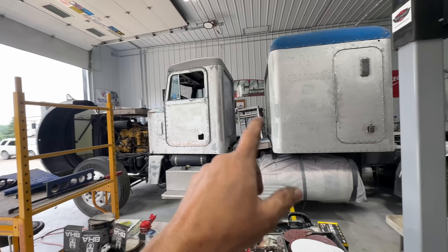If it says wait 20 or 25 minutes between coats, you want to set a clock and make sure you don't start putting the second coat on until that flash time occurs. Otherwise you encapsulate it and get what's called orange peel. Now even if you get orange peel, you can still fix that — on snowman, I fixed it by getting a sponge and a 2000 grit sanding palm sander and hand sanding the entire truck, then getting out the buffing wheel. But if you follow the process, you may not have to do quite as much sanding and buffing.